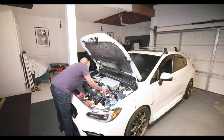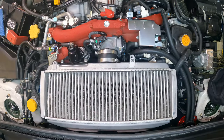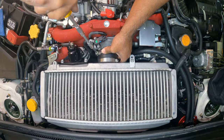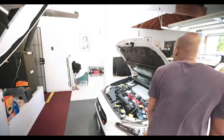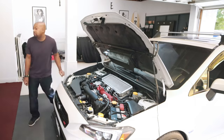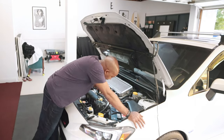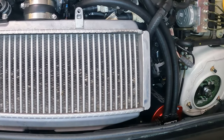The intercooler was kind of a pain in the butt to put back in — having that pit to reconnect the Y-pipe made it a lot easier. It's all connected back up again. I think I'll plug up the battery and then we go for a first start. Now we just gotta check, and then recheck, and then recheck some more to make sure there's no leaks, no holes, nothing. Now we just gotta open that bleeder valve to bleed the air out of the AOS.